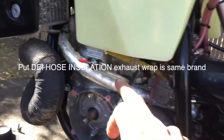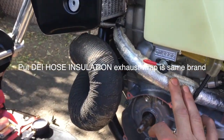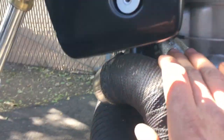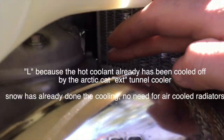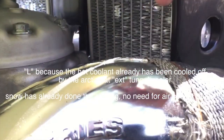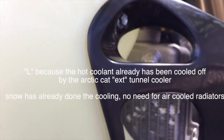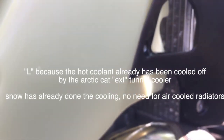The cold side of the tunnel cooler basically just runs straight back to where the carb bypass is. If the thermostat isn't open, coolant comes out before the thermostat through the carb heater and back into the cold side — which is insulated so it can warm up faster when just bypassing through the carb heater with the thermostat closed. Then that goes back into the radiator in kind of an L-shaped configuration.